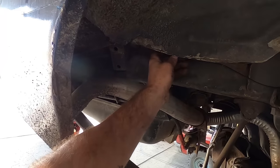Drilled a hole through the trunk by the wheel housing, and then I slipped some vacuum hose over the airline here. Tech tip of the day, always protect your hose. Put a rubber hose over your airline, just find a rubber hose that's slightly bigger diameter. Usually when I'm running my fuel line, that's what I learned in derby car days. You had like a 3/8 fuel line, get yourself some 5/8 heater hose, slide your fuel hose inside of your 5/8 heater hose, and boom, you protected it. So she won't rub through where we drilled through the floors.